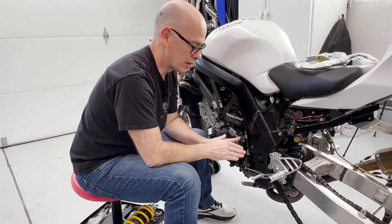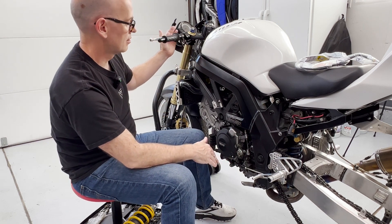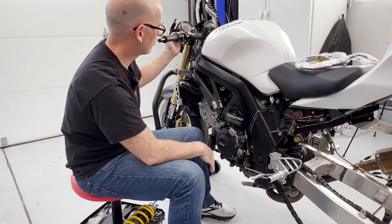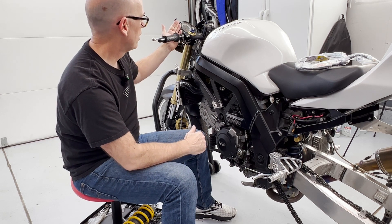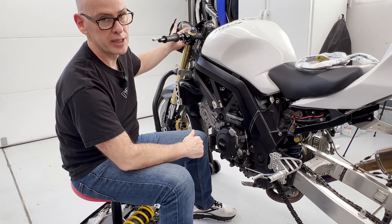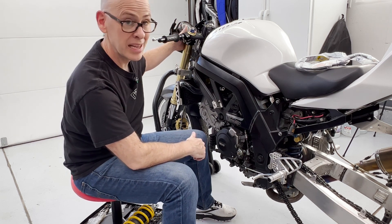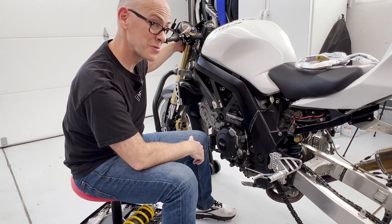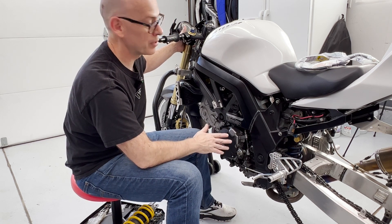The reason I'm doing this change right now is I have a different clip-on. I've gone aftermarket with that, and you can see my video on that as well. That has necessitated this because now my geometry up around the headstock is different. I attempted to make the old one work, and it was really close, but I ended up needing to replace the cable altogether.